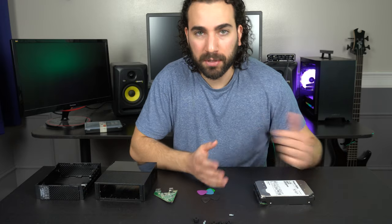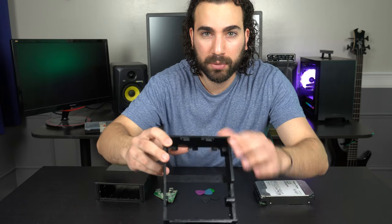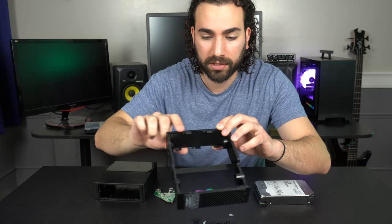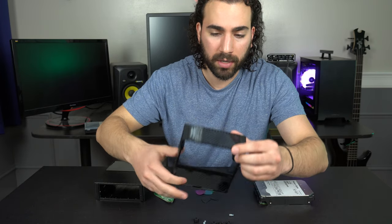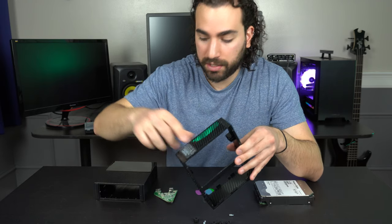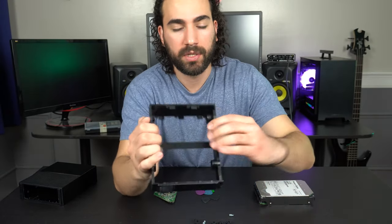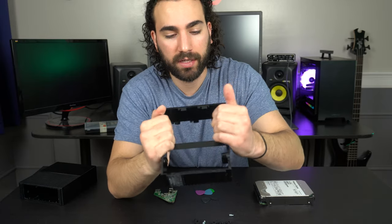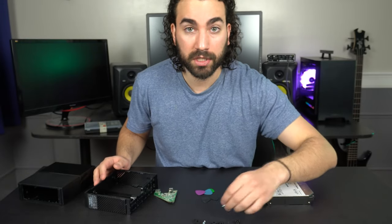I managed to get the drive out. It wasn't the most difficult thing, though if I were to do it again it would be a lot easier. Basically you push in on these tabs with the guitar pick — there are two on one side and three on the other. That opens the top part and then you wiggle it around. The bottom part was where it got difficult for me — I had to use a flathead screwdriver and push in on the edge. One side was easier than the other, so you work around it, push in the drive carefully so it doesn't fall, and slide it out. Once out, you can flex it to pop out the side with the rubber grommet, then remove the screws and you're good to go.